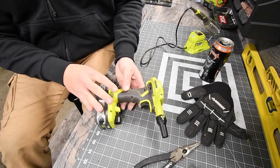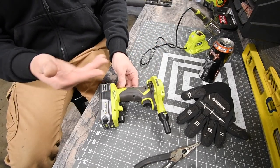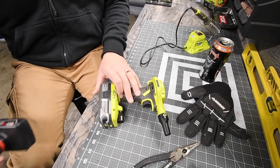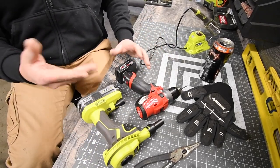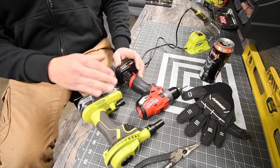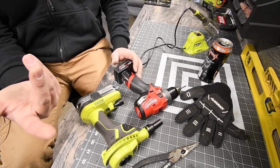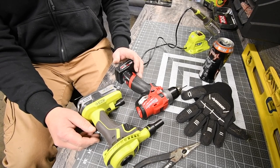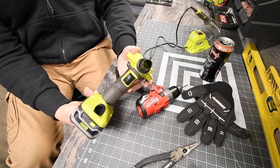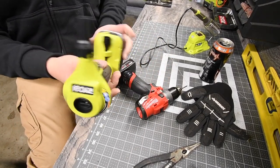As you can see, it is better to take your tools apart, fix them, and not just buy a new one. If it is under warranty, of course take it under warranty. But if you can do it yourself, try to do it. Like if you have old tools that are on their last leg, take them apart, see how they work, see how things are organized inside. You just get used to what the actual components inside do and what needs to get fixed. Obviously this one, a wire was disconnected to the power source, and all I had to do was solder that back in. But if you don't take this stuff apart, you won't know how to do that. It's better just to get a little bit of experience — tinker a little bit. It's worth it. I saved 30 bucks by doing that.